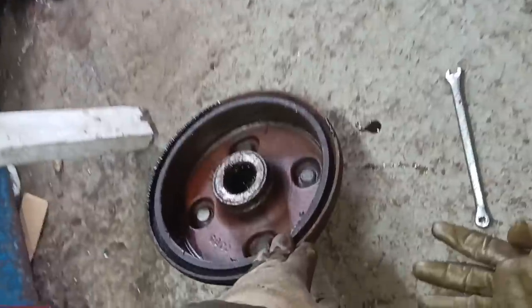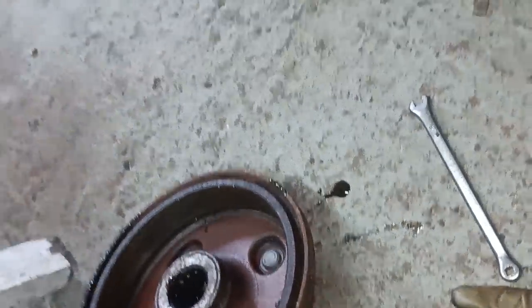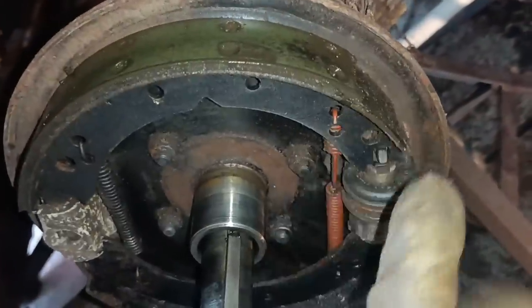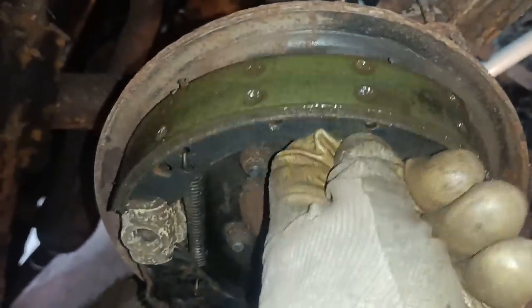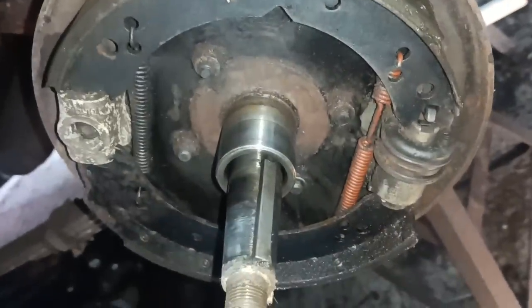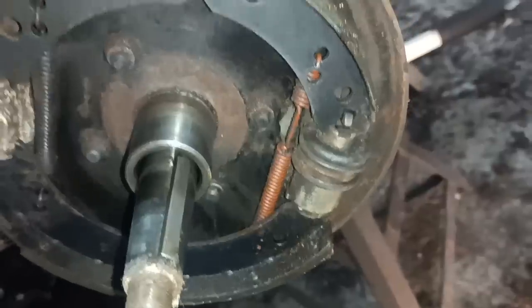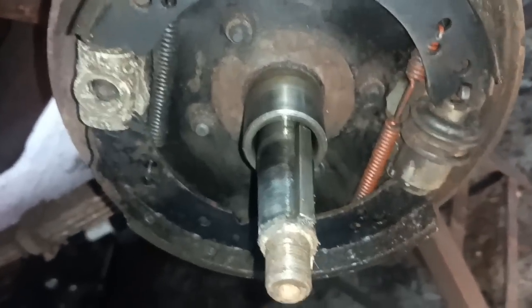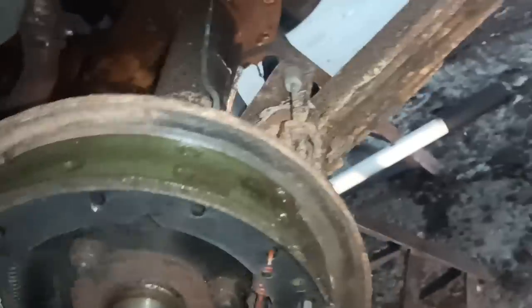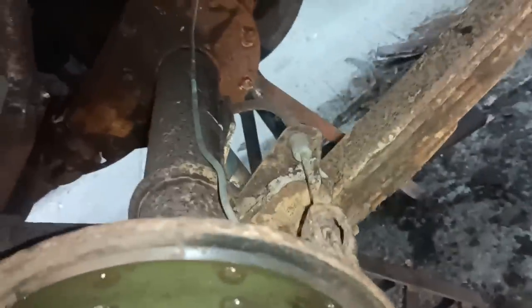A quarter inch. That's the brake drum. There's a lot of fluid in it, so I think this is where all the fluid went. Well, I'll see what the other side looks like and what the fronts look like. So I need new rear shoes, or unless these can be cleaned and washed out, and possibly a cylinder. Yeah, okay, it's just a look-see, because I just got those front brakes. I thought I'd see what the back brakes are like. I might as well get this off, because it all wants freeing up anyway, doesn't it?